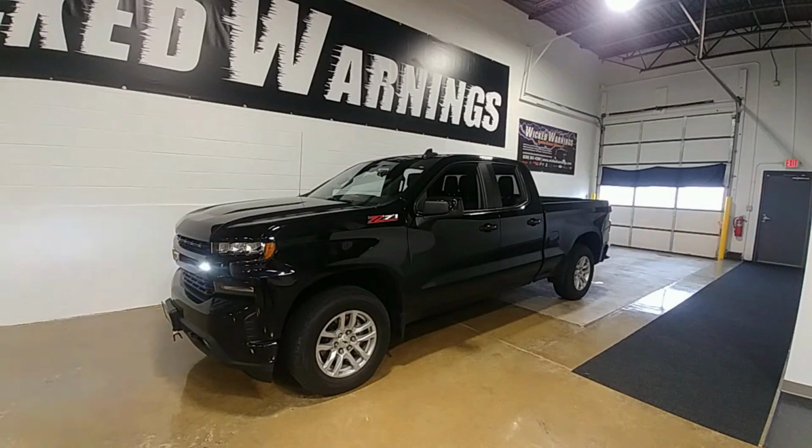On these particular Chevys, you can grab power from the side of the fuse box. There's several terminals right in the side of the driver's fuse box there where you can grab power. We're going to go ahead and put a fuse kit in there for you so you can fuse that power that you grab. And we're going to put a 3/4 rocker switch as well so you can drill it into the dashboard there where the factory switches go.